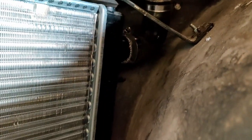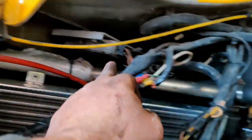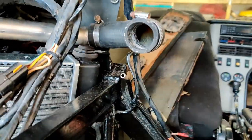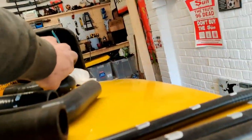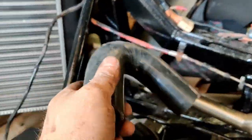A bit of progress - the cross pipe is on. There's a brand new silicone hose in that corner, so it comes out the top of the radiator, goes along there, goes into the top of the engine. I've done the same in that corner but you can't really see it because it's right in the back in the corner - it's a bloody nightmare. I've connected this one up so this will come out and go in - that goes up to the water pump. I need to get in that door to do a U-bend.